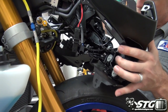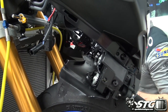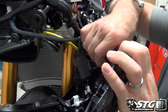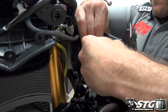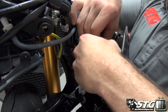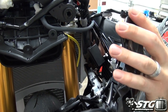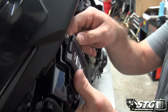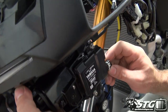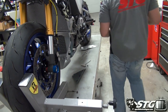First thing that needs to happen is you have a secondary fuse panel that is hooked into this trim panel here. I had to pull that out from its mounting. Now if you'll come over here, bud. Wiring connectors. Okay, we've got one here. These are all going to be lighting connectors that need to be disconnected. Release the tension on it. Pull that one, and then we have two over here on the light control unit, if you want to show them that. Right here. And there you go. Your whole light assembly is now off the motorcycle.